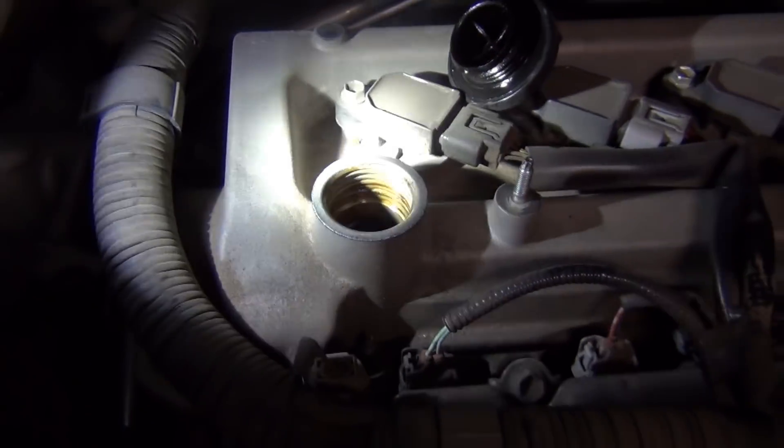Here's what that petcock looks like — just with the little thing sticking down. The hose size — this is just transmission cooler line, it's a 5/16ths. It's a pretty good fit, holds on pretty snug. With a pig mat and some ice cream buckets in place, I'm going to crack these bolts loose. As I do, you'll see that it starts to leak around the sides — that's normal. There's a little bit of a hill to get over with the coolant between the thermostat and the radiator, so it'll just kind of drip on you. Drain as much as you can from the radiator and then prepare yourself because it's going to drip from the water pump — it's always a little bit of a mess. Getting the water pump out isn't too hard in terms of bolts, but when you go to pull the pump itself out, you'll find that it just hangs up unless you get it exactly straight — and if you get it exactly straight, it barely slides out. There's not a millimeter to spare, but it will come out.